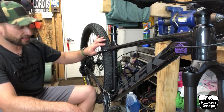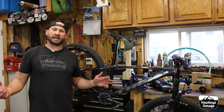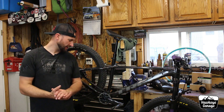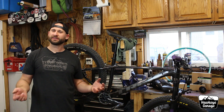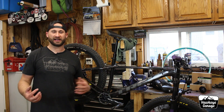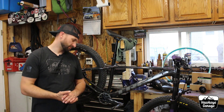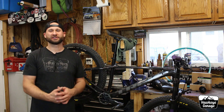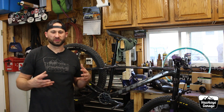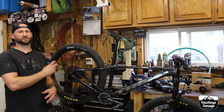Let's fast forward — get the crank boots and the pedals put on and set it back on the ground. That pretty much wraps it up. Thanks for sticking with the video. I know it's a little bit longer, but it's kind of detailed if you haven't done this before and I tried to cover as much as I could. I've ridden it around the block and it made a big difference. Even just riding it around the block I could tell — much, much better. I actually have taken it out on the trails and ridden it. It is so much better. The bike feels so much more solid and I feel like there's less flex in the frame. Now I just need to do something about this rear hub.